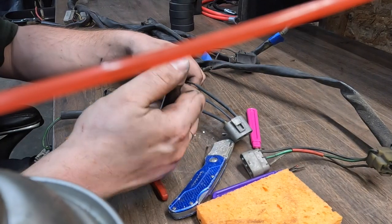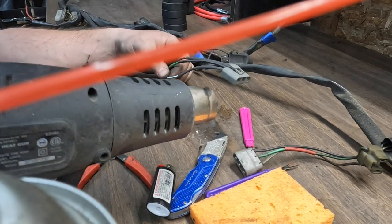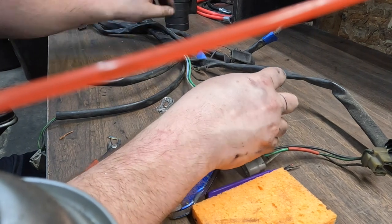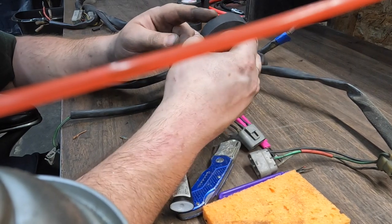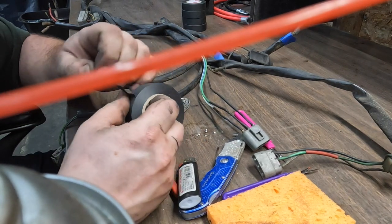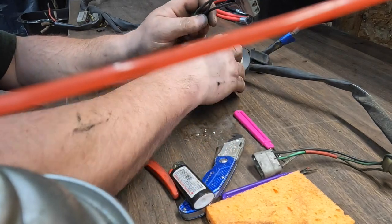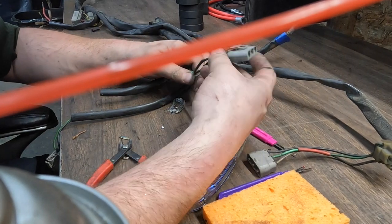For shrinking, the old BIC lighter is always an option, but if you're going to be doing a bunch of them, just spend the money and get a heat gun — it'll make it easier in the long run. Once we get the rest of the harness cleaned up and laid in where we want it, we can come back with the felt tape. This beats by a long shot regular vinyl electrical tape — the vinyl stuff will let water in and out, and it can't breathe or flex as well. That's one connector down, only about 17,000 more to go — montage time.